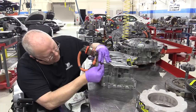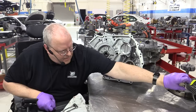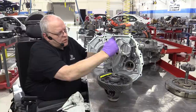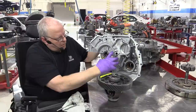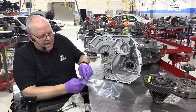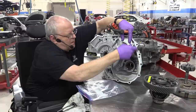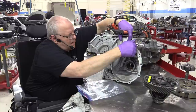Let me tip the case up on its side here. We've got the final drive ring gear that's going to fit, or goes right in this space here. And as this ring gear rotates, it flings oil up into oil catch areas to drip down to lubricate bearings and gears and so on. There is a little shield, kind of a lubrication dam. That goes right here